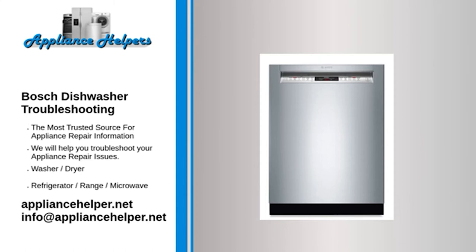Cleaning and descaling your dishwasher a few times a year will help remove greasy residues and hard water buildup and help improve cleaning efficiency. Maximize drying by using rinse aid and selecting the extra dry option. Clean your filter regularly to help improve cleaning. Load the dishes properly, ensuring there's adequate space between items, and check that the spray arms can move freely after loading. No need to pre-rinse dishes before loading — just make sure the food is scraped off the dishware, as detergent needs small food debris to cling to in order to work properly.